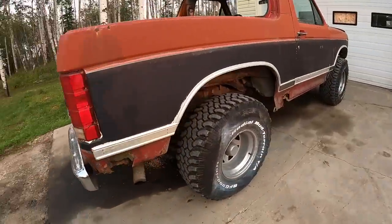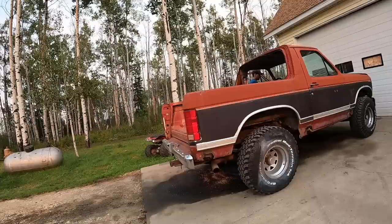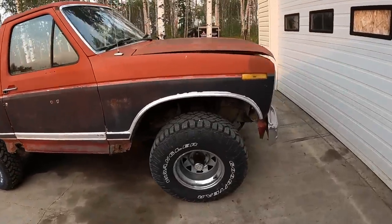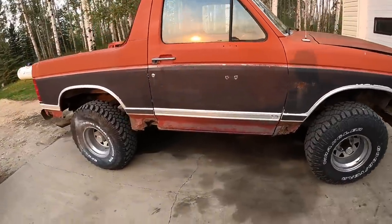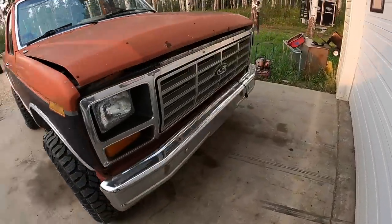Never fails. Anyway, it's running. Gas tank still leaks a bit. Fuel pump came around, that's good. Well, she sends pretty good. Only got rear brakes though. I think the calipers might be seized. I'm gonna put it on the hoist next time. Screw working on the dirt. And should have it on the road here shortly. Thanks for watching.